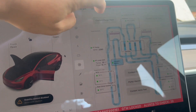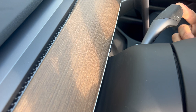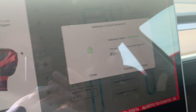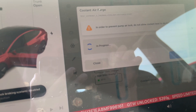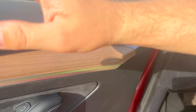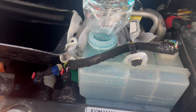To do the coolant purge: make sure your key is right there, hold the brake and the right turn signal. Press 'Coolant Purge' — it will give you a countdown: four, three, two, one. Then you'll see the service screen. Press 'Coolant Purge Start,' run it, and once it passes you want to go to the front because it will start purging your system.